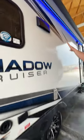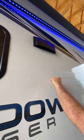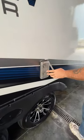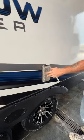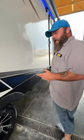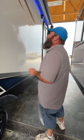You've got the vent for the stove here. Always make sure that is open when you're going to cook — if it's not open on the inside, when you turn your fan on it isn't doing its job properly. Next we've got our furnace with intake and exhaust. We always recommend that you have mud dauber screens on here, and as you can see there's already one on here — it helps keep the wasps and mud daubers out from building nests that can create potential issues, because shop rates are not cheap.